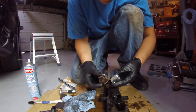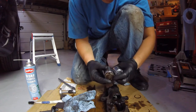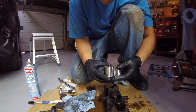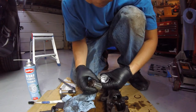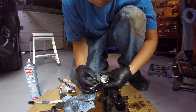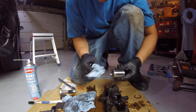Some good news — the B6 rear caliper pistons are exactly the same: 38mm diameter, same length, cut-outs are all the same. So it looks like what I need to do next is transplant the internals of the old piston — a shaft with some weird discs behind it — into this new shiny piston. Then we'll see where we go from there.